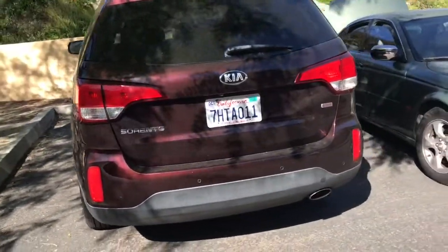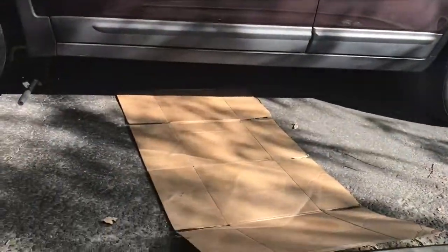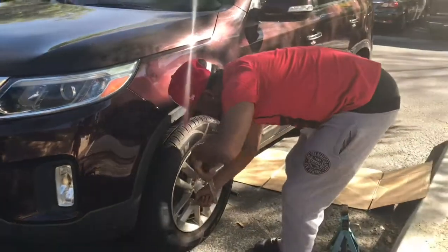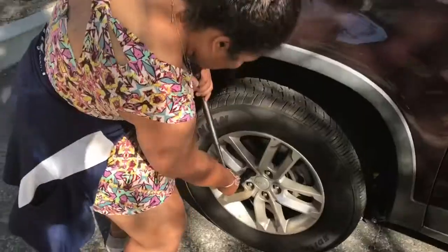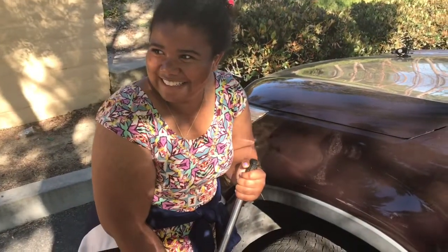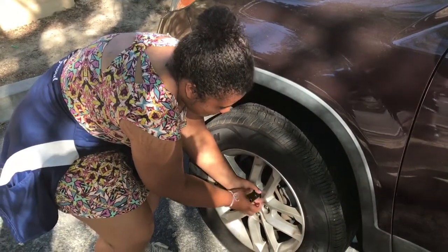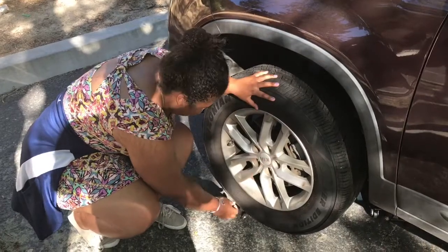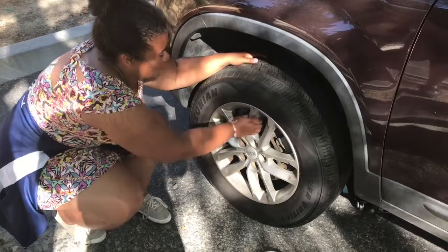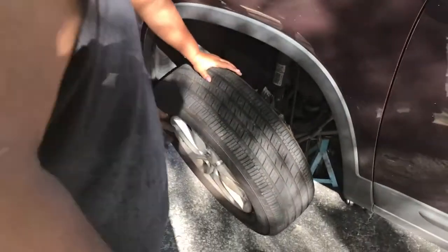That's my dad and Rachel's boyfriend Josh. What we've done already is put the jack in position — it's underneath the car. He's just going to go ahead and loosen the lugs, just loosen them. Josh already loosened it, so I'll use this tool and just keep turning — it'll just come off. As you approach the last lug, just keep going, make sure to hold the tire, and boom — that's how you take off the tire.